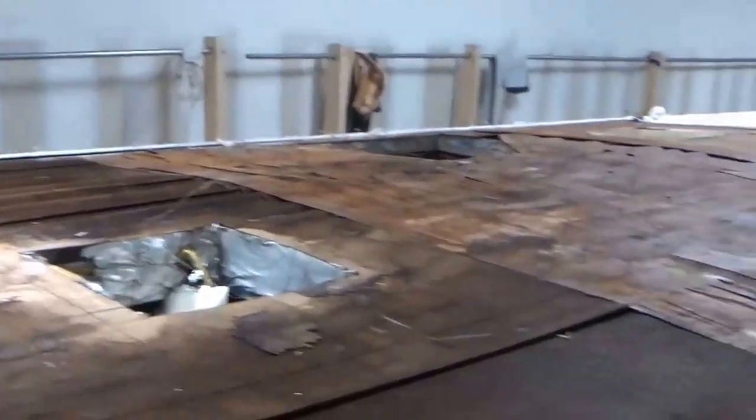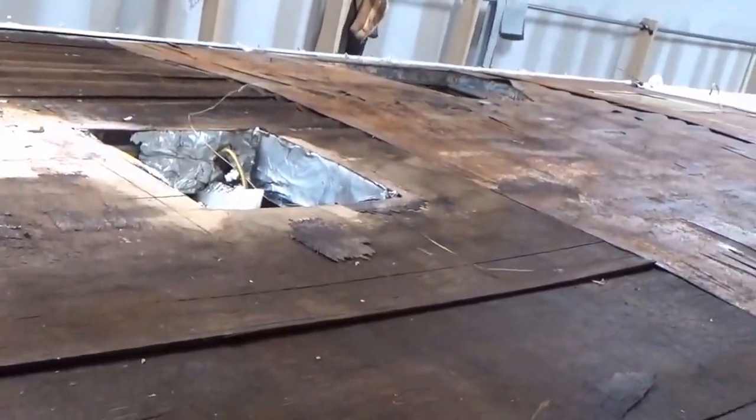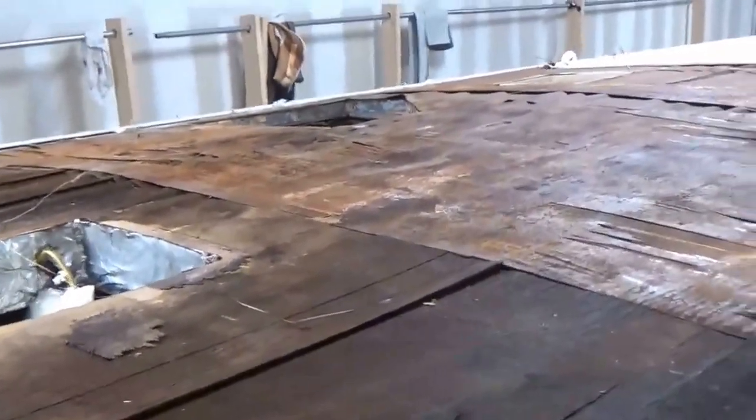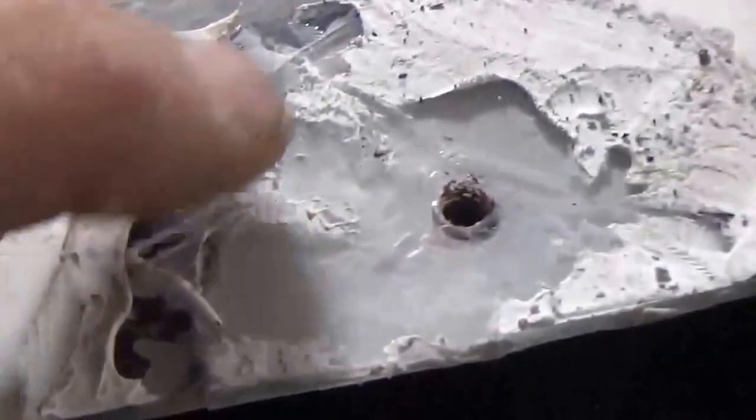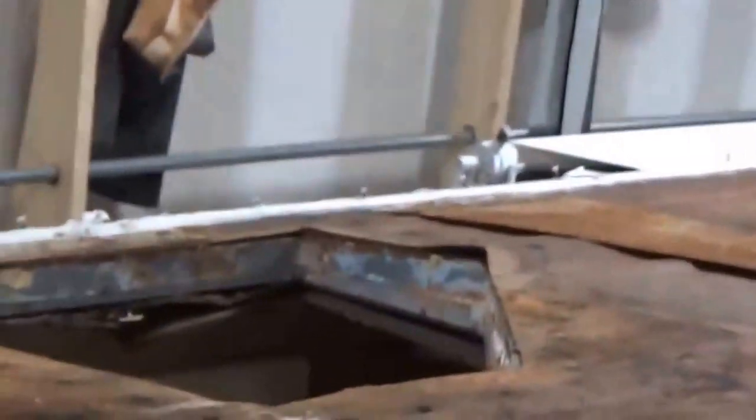I want to show you the shower lens, which, here it is. Here's a shower lens. It's got a crack in it right there, but also when they put the screws in, they over tightened the screws and caused all these hair fracture cracks in there. You can see them. All these hair fracture cracks that are in there. There's quite a few of them. Here's another one over this way. Here's another one, another crack. And these contributed to some of the leaks way over on the other side.